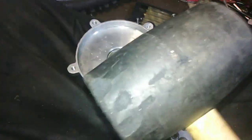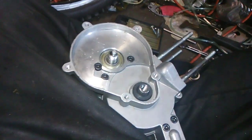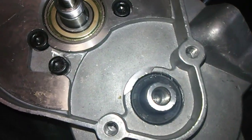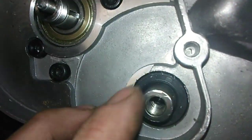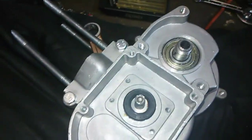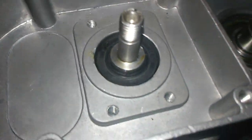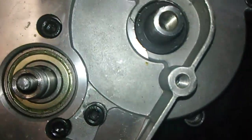Get this leveled. That's how you do it — you learn something on this channel. She's in there. Hopefully you're learning something. Now let's do the magneto side — fat seal. It goes in like that and then you whack it with the hammer. Not bad for a first-time builder. I did the same thing for the Phantom when I rebuilt it. That's how you get them in there.